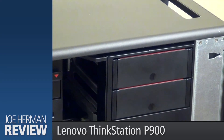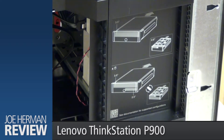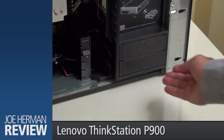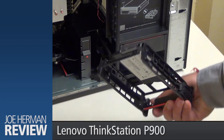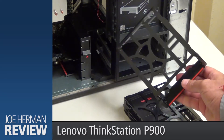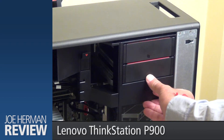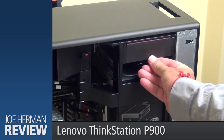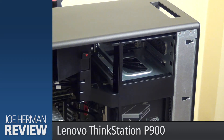Towards the front of the workstation are the hard drive bays, which allow you to scale up to 11 drives internally. Onboard RAID is included with options for RAID 0, 1, 5, and 10. The ThinkStation P900 features newly designed flex drive trays that allow you to combine two drive sizes in a single tray. The flex trays can be configured to accept either a 3.5-inch and 2.5-inch drive, or two 2.5-inch drives. The flex drive trays also connect to the system without the need for messy cables. Lenovo's flex solution also contains a motherboard connection that allows you to connect different kinds of drives — such as SATA, SAS, PCI-E, and M.2 — as needed.